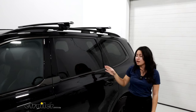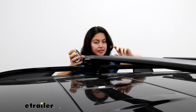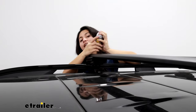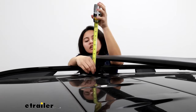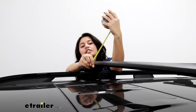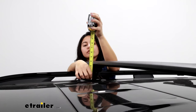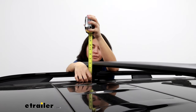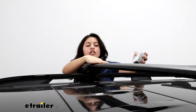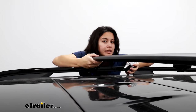In the case of the Telluride, since you can put your crossbars anywhere, it doesn't really matter that much. You also have to consider your roof height clearances, and there are two measurements there. The first is the distance from the roof to the bottom of the crossbar — that's how much space you'll have for clamps, wingnuts, and U-bolts. Here I have it measured at around three and a quarter inches. The next measurement is the height this adds to your roof: from the roof to the top of the crossbar, it's going to be about four and three-eighths of an inch. That's going to be on the slightly lower-profile side for different roof racks, with still plenty of space there.